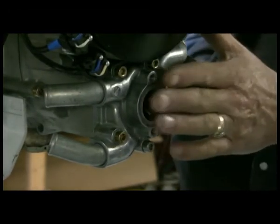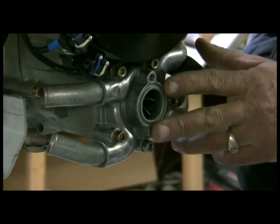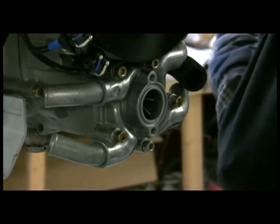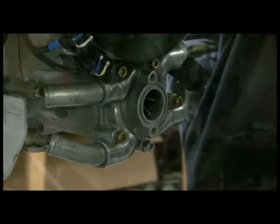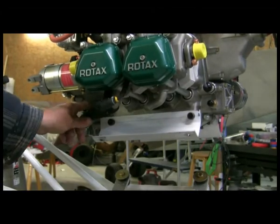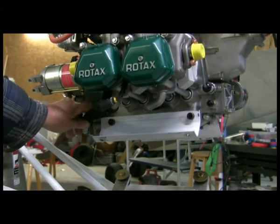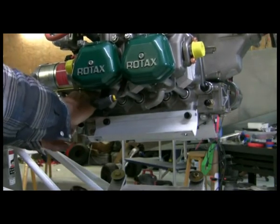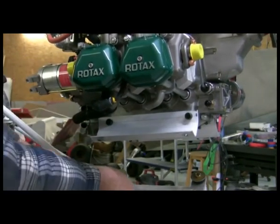I'm not going to put the O-ring back in just yet. We're going to leave this off for a bit because I can easily access it through here — there's lots of room in the back to be able to move stuff in and out. So we've just reinstalled the water pump housing just finger tight. What we want to do now is have a quick look at how our pipes are going to lay.